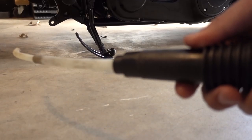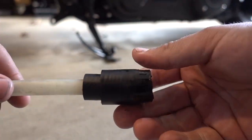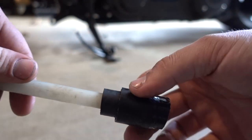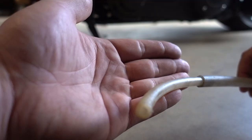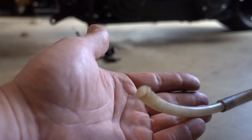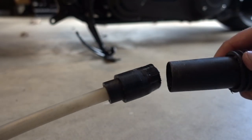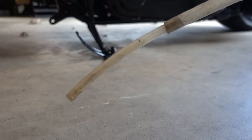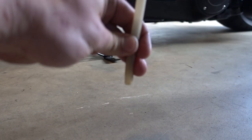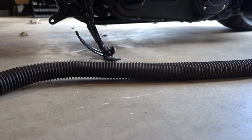Here's my fancy tool. Here's the end of my vacuum hose, and then I really just have rubber hose bushed down to plastic tubing. You can see the size — it's just real small, maybe like a half inch or so by the time it necks down to that. I just stick it in the end here, and especially when you're doing studs and stuff like this, you can really point this straight down and clean up that injector bore before you put that in.